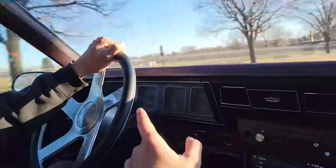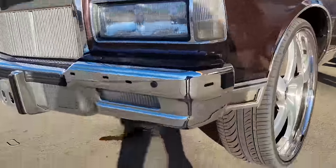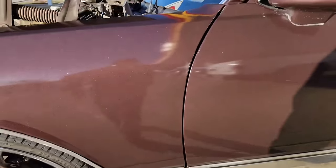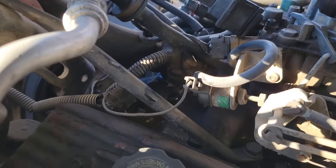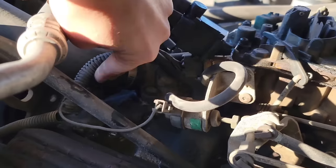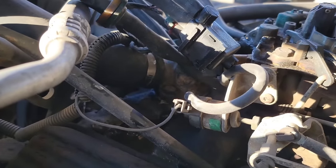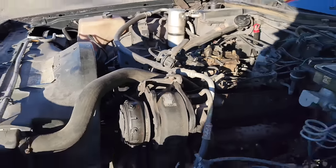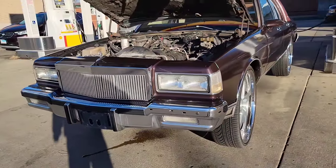Hopefully it was just low on gas because it was sputtering and it didn't want to go. We're gonna see if the needle works on this one. All right guys, we figured out the issue - look at this, it started leaking antifreeze. We thought it was trans fluid but it's actually leaking antifreeze, and I figured out it's from the top hose. So it's not gonna be a bad fix. Right here it's leaking - if I squeeze it you can see it. We have to cut that and scoot over more just so we can try to make it home.